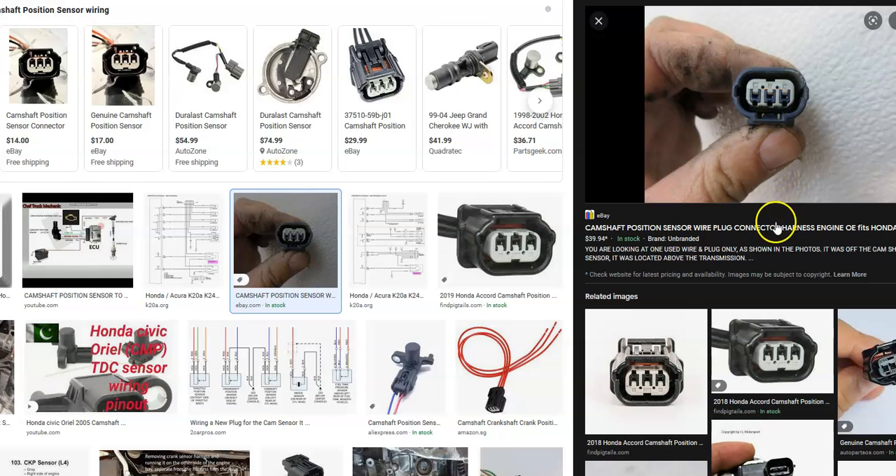There are some YouTube videos on that testing method if you want to check it out. Also worth mentioning — quite often this whole circuit is on a fuse, so you want to check for any blown fuses. Usually inside the engine compartment there'll be a fuse box, though it can also be up under the dashboard. If the fuse blows you won't get any power to it, so there would be no reference voltage at the plug.